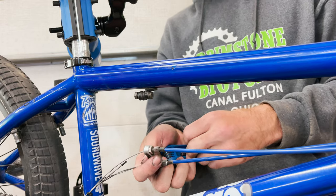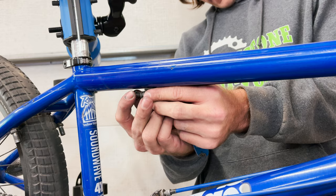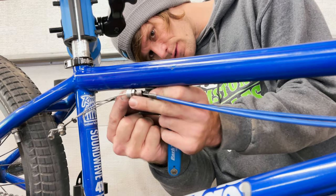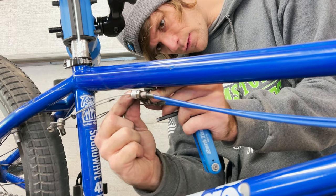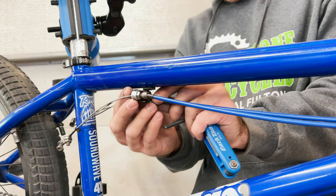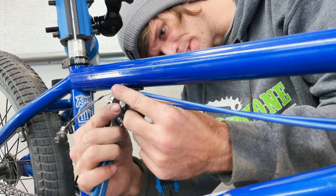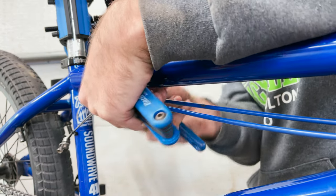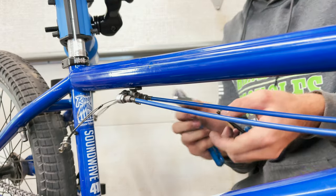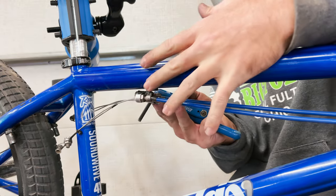To install the London mod, take the bolt out if it's already in. I have some custom spacers here — they're just brake pad spacers. Slide this over the bolt, put the spacers back on, then replace the nut on the bolt. Get it centered and tighten the bolt up. It's worth noting there are several different types of lower cables as well, and which ones you have will dictate your brake setup — something I'll cover in a future video.